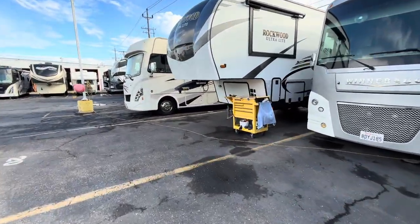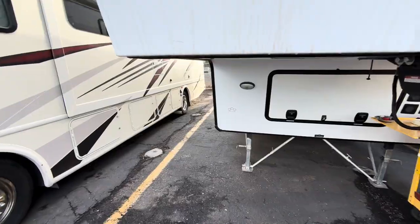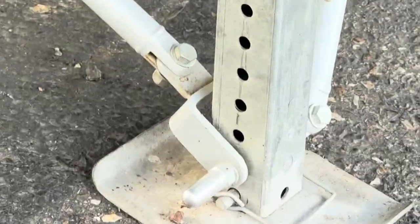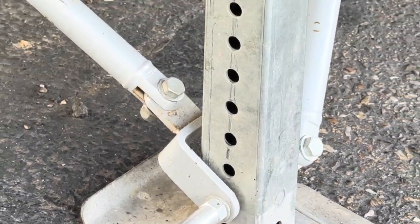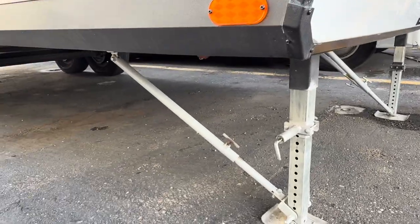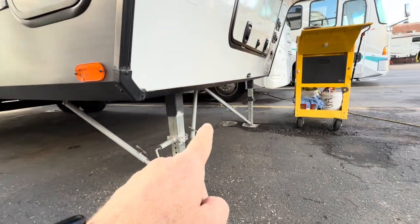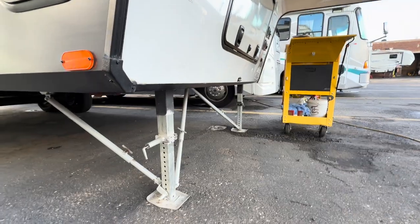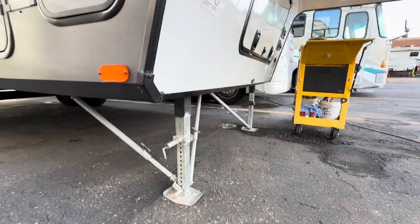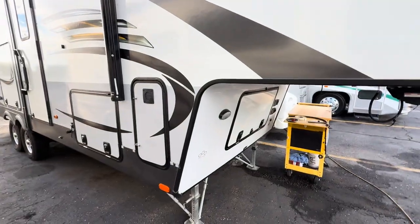This one over here on this Rockwood, I think one of my guys was working on the Winnebago back here behind me, so I'll go to a side view. It's the same setup. This is a newer version of the JT Strong Arm kits. As you can see, there's that same lifting handle that they've added to it, and those same rods. But what's unique is, see how this one comes back in at, what do you want to call that, a 45 degree, and connects? That stops all the back and forth. These two stop all the side to side. Depending on where the main I-beam is, this one actually goes back. Some of them are up front, so you can just connect to them easily. But that firms up this whole unit from the side to side action as well as the front to back action.